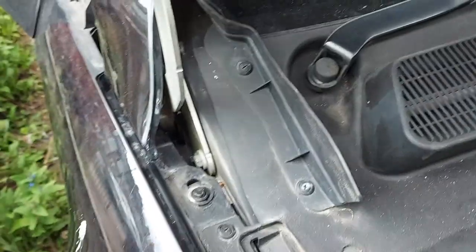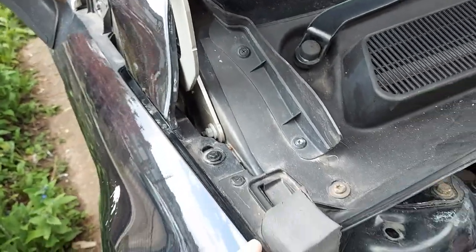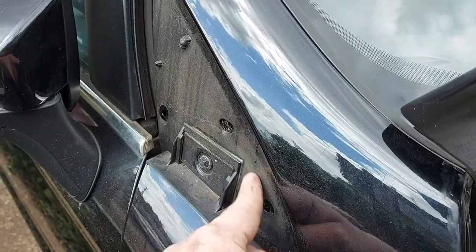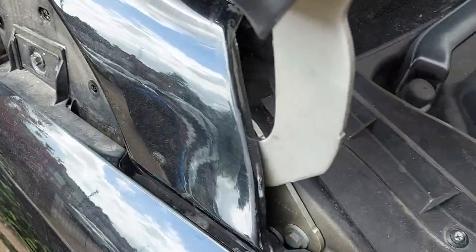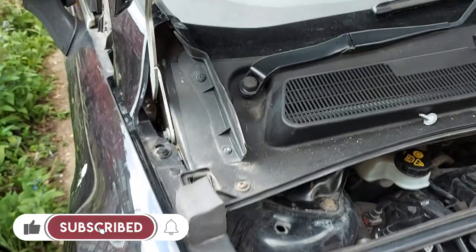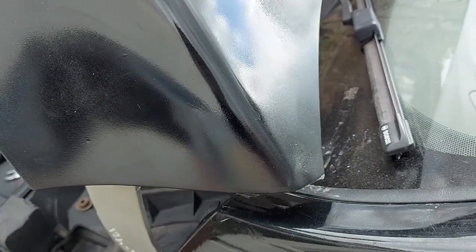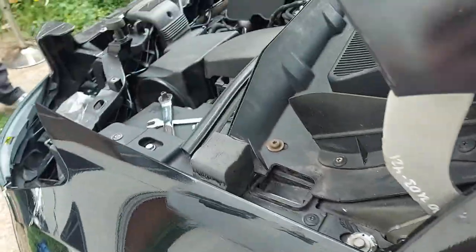So we've got some shiny new hinge brackets in there. To get at them you have to undo all of the clips down here, pop the trim off this A-pillar piece, and undo that. That then gives you space to pull back the plastic wing sufficiently to get in those bolts and get them adjusted. Then it's just a case of putting it back on - same on this side. I've bent the bent bit of bonnet back so we'll just have to touch that up along with the rest of the bonnet. We're there or thereabouts.